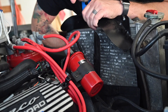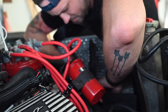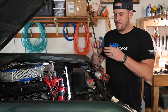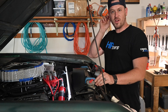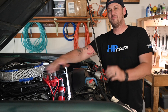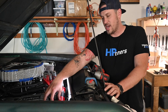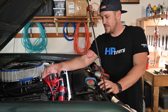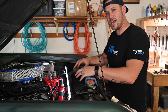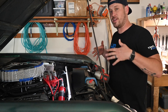Put some gloves on when you do this. Now I've got the fan shroud on and the fan in. I'm going to put the holders back in place that hold the radiator. I also moved some of my heater hoses and cleaned up my spark plug wires to try to get some air movement over the headers. Just to say it again — I'm not expecting the fan shroud to do a lot of impact inside the engine; it's really helping direct the air going through the radiator.